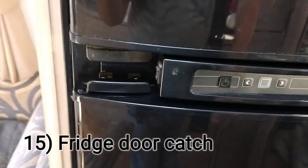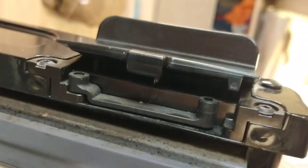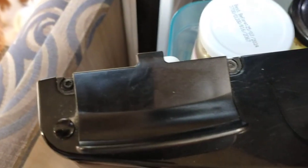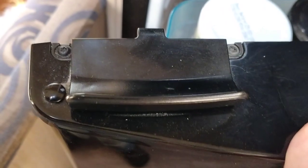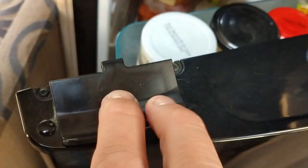The fridge handle on top - it's just a small spring inside that breaks very frequently. I've made a video on how I replaced it. All I did was buy another one - you can even buy them off Amazon. You just undo the two screws on either side, the handle comes off, screw in the new one and away you go. It's pretty easy. Since I did that video about a year ago, this one has broken again as well.